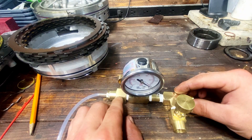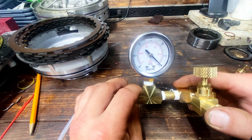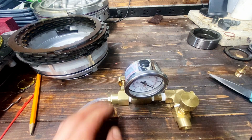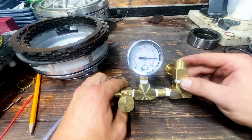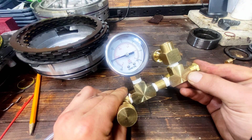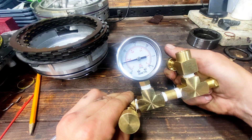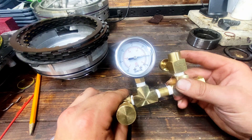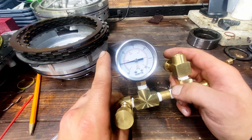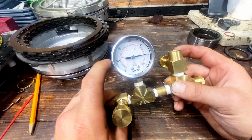So as you guys have just seen, I got it on five. I plug the hole and it's actually a little under 25, which means I've got a small leak somewhere — I'll have to re-tighten everything. All right, I'm back. You can see we're on five, and I plug the hole — we shoot up to 25. I need to adjust that bleed just a little bit more. But you can see that's how you calibrate it. All I had to do is tighten everything up a little bit. Apparently I had just a very small leak that was affecting things. Twenty-five plugged, come down to five — that's really it for calibration. Once it's calibrated, you can move on to actually testing.